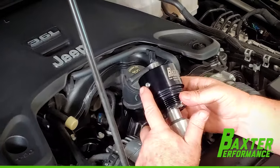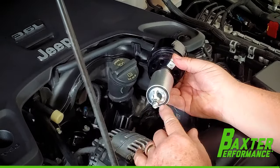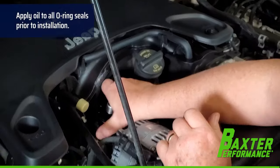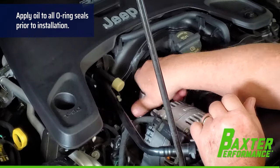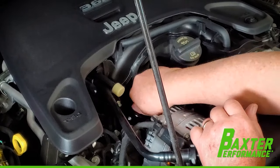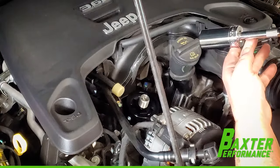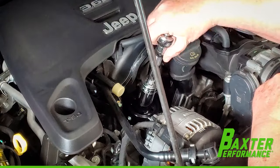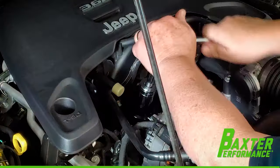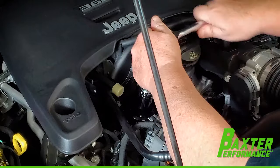We've installed our 1-1/8 inch plug, our o-ring on the body, and our o-ring on the tip. The o-ring base of the docking collar comes pre-installed and we're ready to go. When tightening, you're going to need a 1-1/8 inch deep socket to actually match the hex profile on the adapter itself and run it in. You want to pre-oil your o-rings prior to install as well.